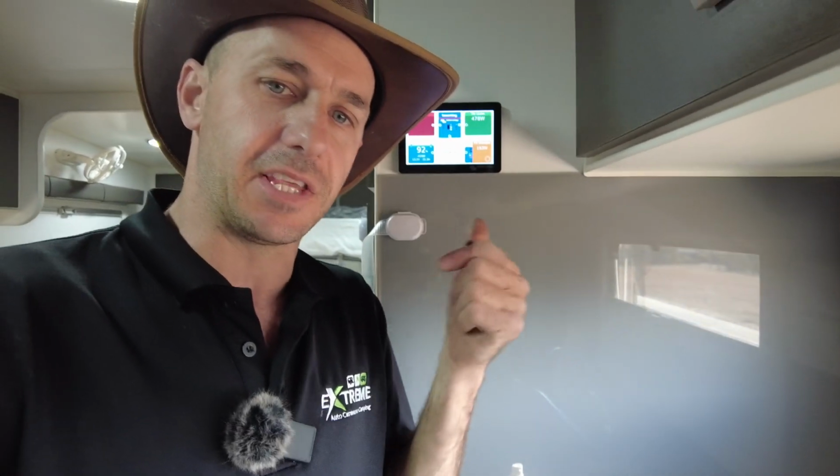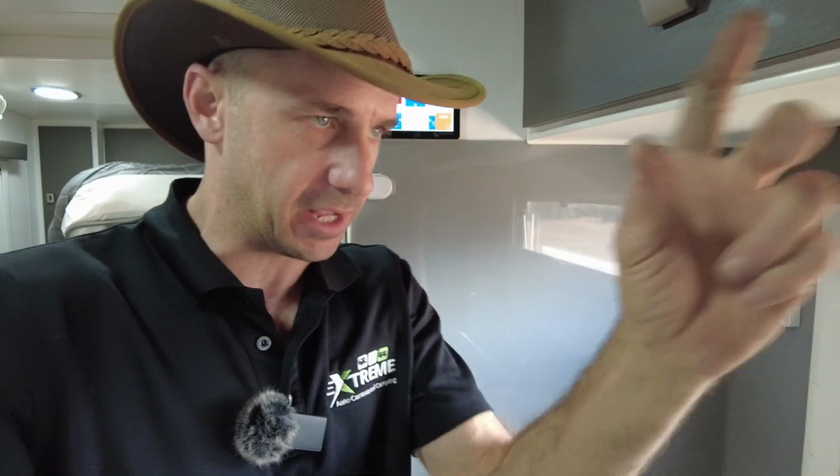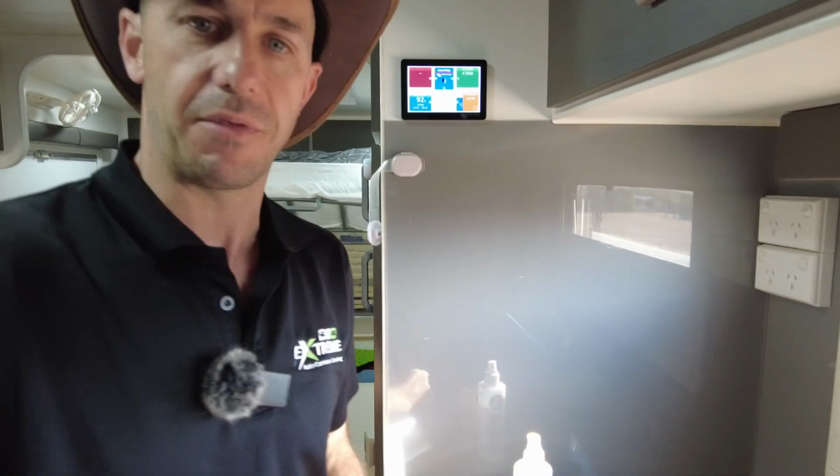If you set that for 15 and plug the Honda 1 in, it will try and pull that 15 odd amps, which is, you know, 3,500 watts. Well, a Honda 1 can't supply that energy. All it can supply is about 850 continuous running. So you would set this for 4 amps or something. So it will only pull that wattage from your generator to stop it from clipping off and you running outside to reset the thing all the time.